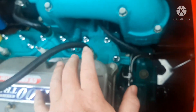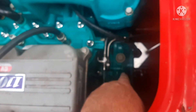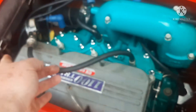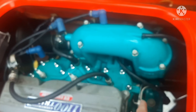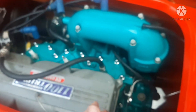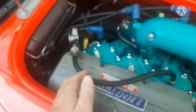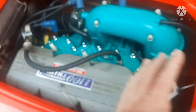This cylinder — I'm going to call it cylinder number one — it's also the magneto side. The magneto is what that cover is covering up. A lot of people refer to the M side and the PTO side. The power takeoff is in the back, the magneto is always in the front. So when you see that on forum posts and don't know what they're talking about, that's what they mean. Whether you've got a two or three cylinder jet ski, that's always going to be the same regardless of brand.